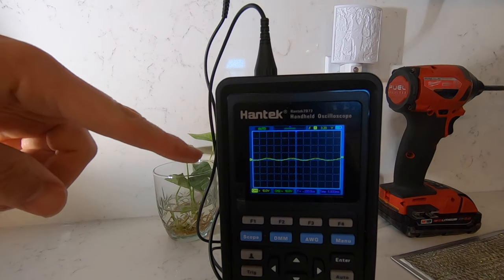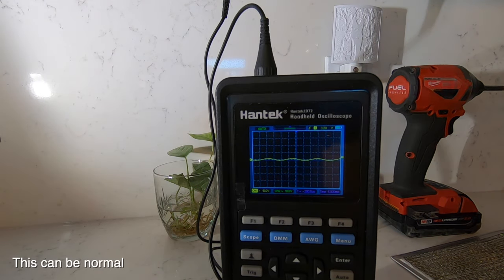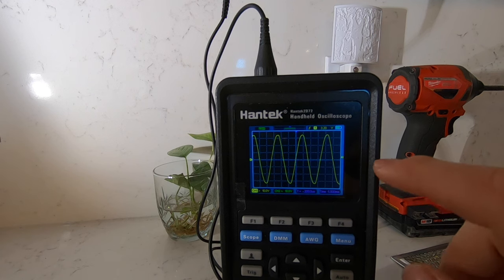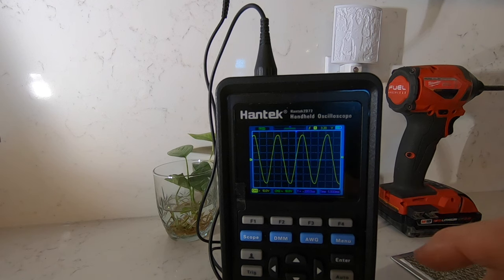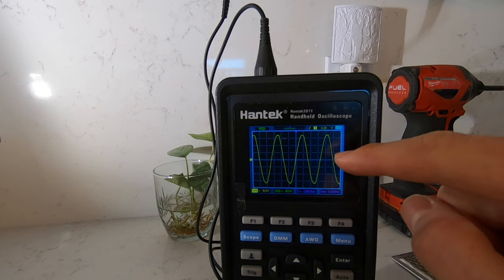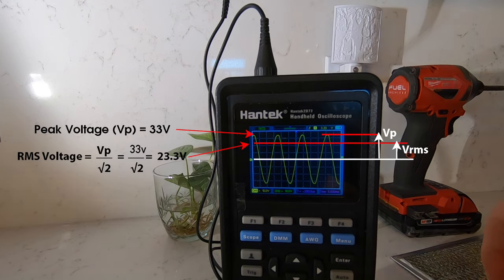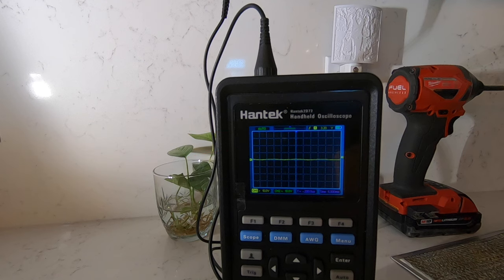It looks like 60 Hz noise there while it's connected without power on. So let's turn the microwave on. We've got an AC signal there. It looks like it would be about 21 volts as the motor says, and we've got 10 volts per division — so 10, 20, 30 — a couple volts, and usually that's an RMS voltage. So that looks good. I'm going to turn the turntable off and we'll see what that does. Turntable off — and it does turn off the power to the motor.